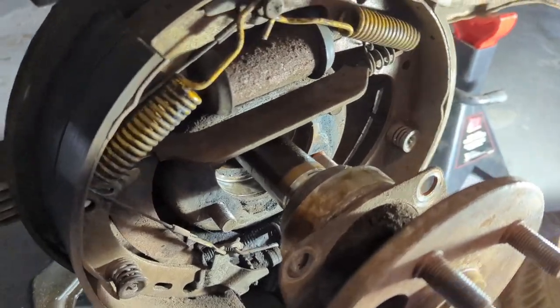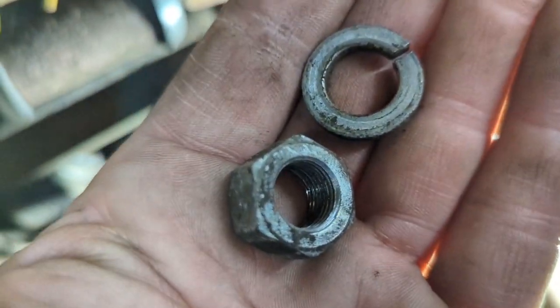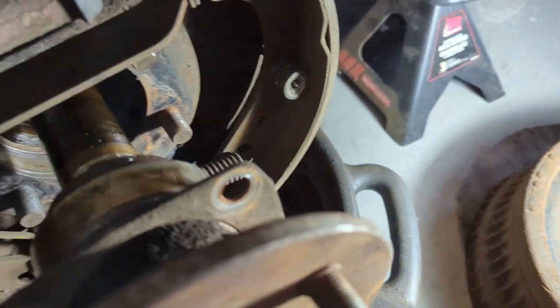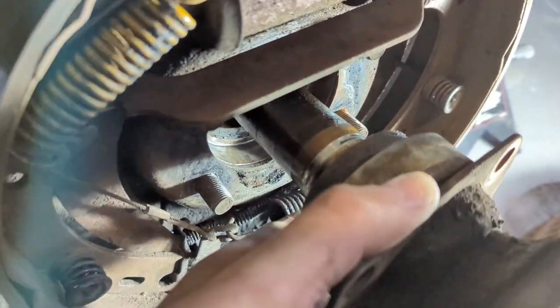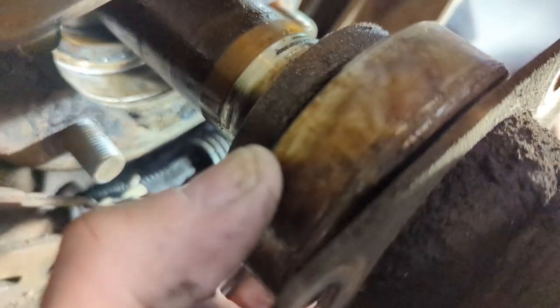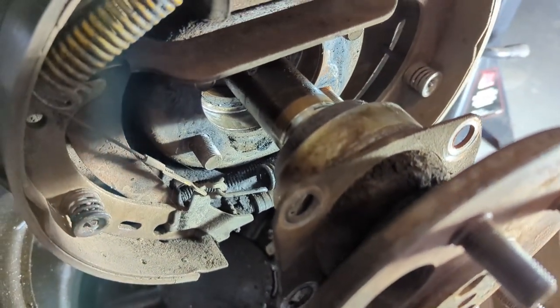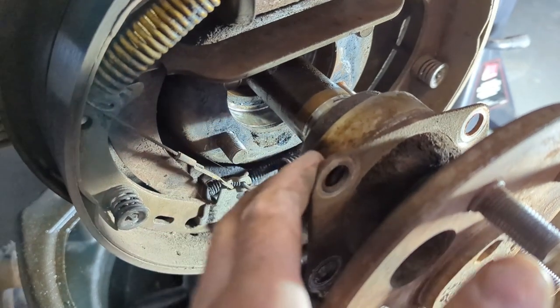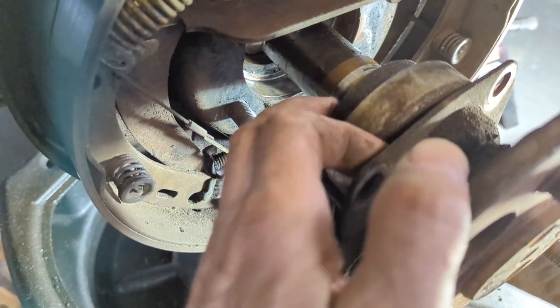That was quick and simple. Someone's been in here before - I can tell because they put a different nut on one of the studs and a locking washer, when they're supposed to have this type here. Anyway, it is what it is. I just grabbed on, pulled it right out and popped it out. But I think this bearing has had it - she's pretty loose. I'm going to pull the axle out and see how I'm going to get this bearing off. I'll probably end up cutting it with the zip cut, and then the retainer collar.